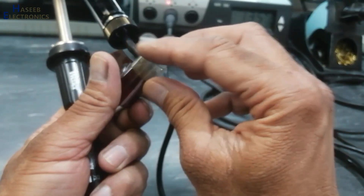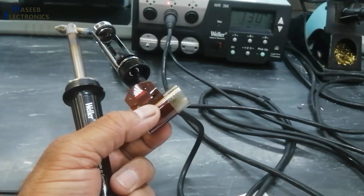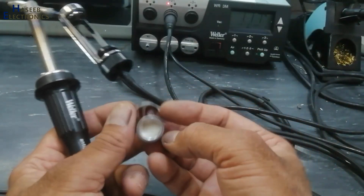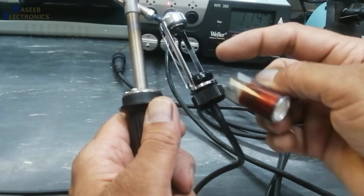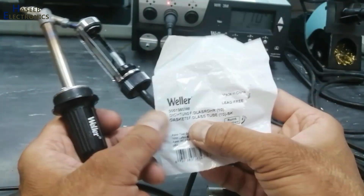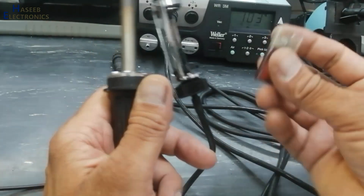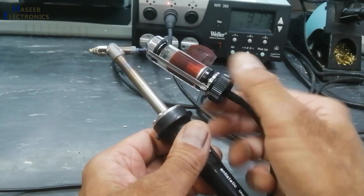Sometimes the glass chamber is broken. If the glass chamber is damaged, it will leak the vacuum from that side. That time you need to use a replacement glass, which you can also purchase online from the company. After passage of time it will develop spacing here, and the vacuum leaks from there. In that situation you can use a gasket here — an additional gasket. Originally there is no gasket, but you can use one here with part number 0051360399. You can use an o-ring, or any available o-ring, between the filter body and this place. So if there is any type of leakage, you can check it.